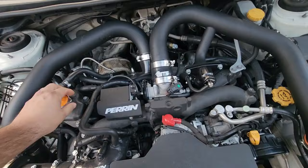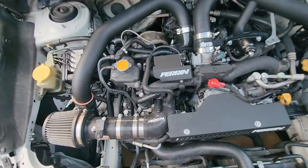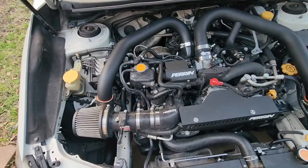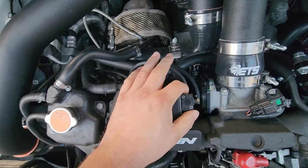We're back with another video. I'm about to start working on the fuel lines. A funny thing I noticed was my line from my boost control solenoid coming off the turbo was actually pinched right in between this Y right here. That would probably explain why I was sitting at 19 to 21 pounds on base boost with no wastegate actuation, because the wastegate spring in the up pipe is set at 15. So I went ahead and rerouted it, came over the top nice and clean.